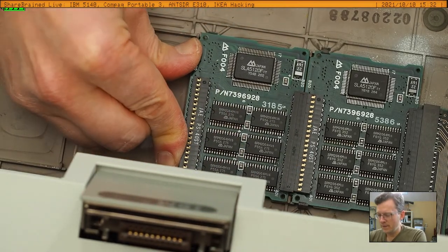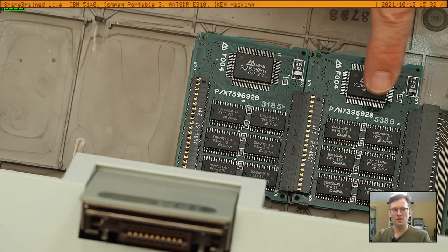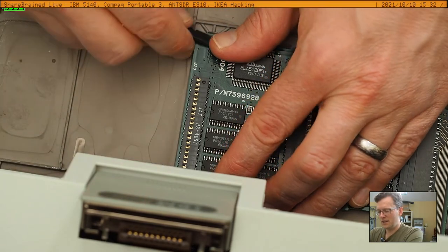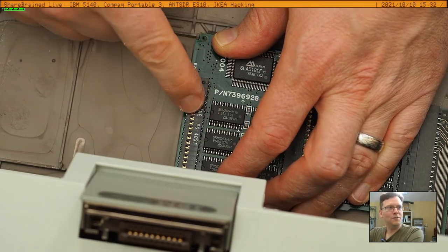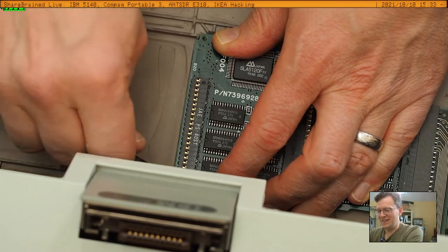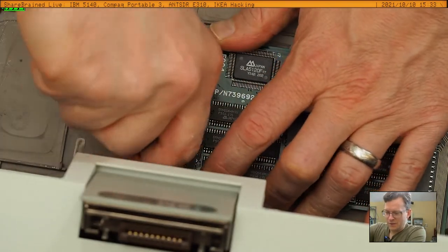Second one slotted in. So if this logic board does not have any RAM on board, that means that the system can only max out at 512K, because each of these is 128, and you can get four of them in. But I do recall seeing some discussion of people basically adding a ribbon cable from the last one of these in the chain, and then chaining in one more, so they can get the full 640, I guess it is? 512 plus 128, 640, isn't it? Yeah. Because 640 should be enough for anyone.